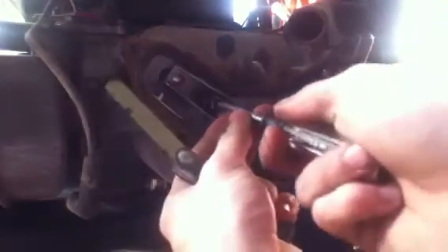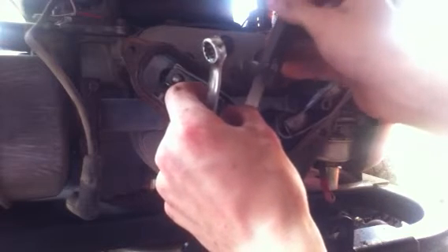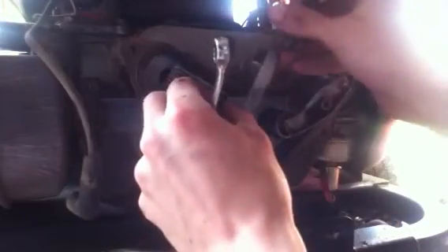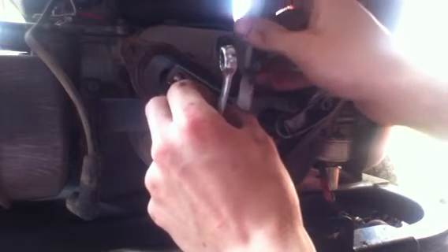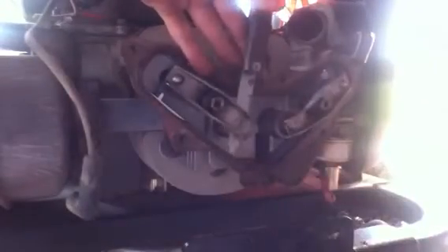We'll start by adjusting the really loose one first. Loosen up the little nut in the center with a screwdriver — sometimes the adjustment is a little different but similar. Thread the adjuster in, and sometimes you may even be able to tighten it down with your hands. You just want to do that until it starts to feel tighter and tighter. Keep going until you feel a little bit of tension between the feeler gauge and the valve — that's when you know you're at the right tension.